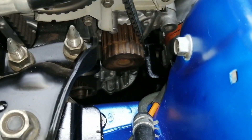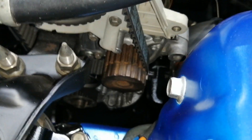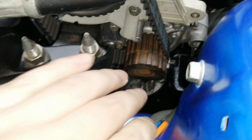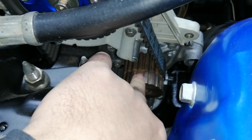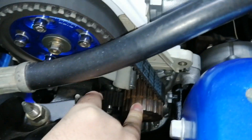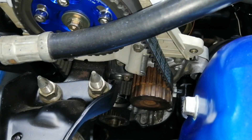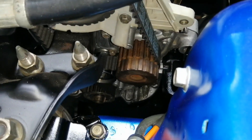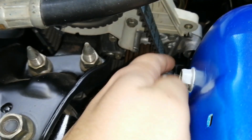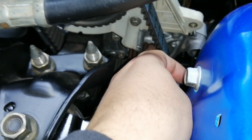This D15Z4 actually has a different style pulley — it looks like it has a weight on the end. I couldn't get this exact water pump; I got one from a D16A6 or A7. To me it looks like it will bolt in the same, it has the same number of fins and teeth, and the pulley is in the same position, which it should be. So we shouldn't have a problem.